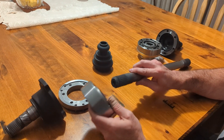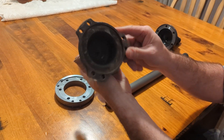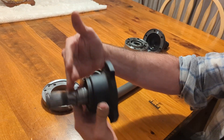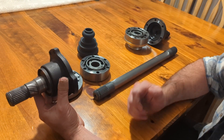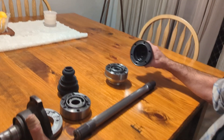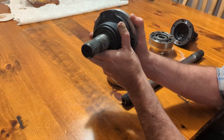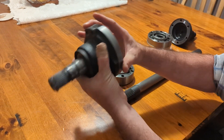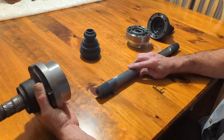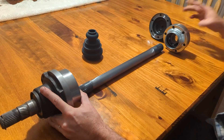That goes onto the same type of CV joint at this end, which then poses the problem of adapting this to the Nissan R200 stub axle that goes in the diff — one of these. This is a 3x2 configuration, commonly found in an S15. These don't generally pose a weak point at this stage from what we've seen, so we haven't yet replicated this piece in billet alloy like we have with the outers. Instead, we've made an adapter ring which bolts to the Nissan stub axle with those two holes, and that adapts the 108mm CV to it.